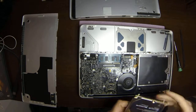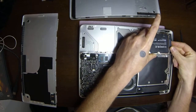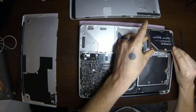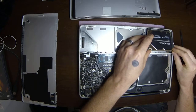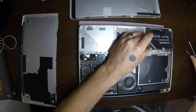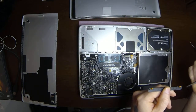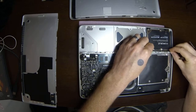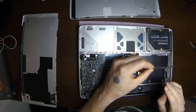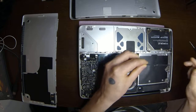So I'm going to put our hard drive back in really quick. You just want to take care of this cable — it's kind of tight in there. Push that onto the SATA port. You always want to put this back side in first, kind of at an angle like we did the memory. The reason being is because those are just holes that it has to pop into. On this side they're half holes which it drops down into, and then they get tightened down. The little bracket will only go one way — this edge has a little bump on it where the screw is, and on the frame there's a little bump that has to slide right in there. Just hand tighten it.